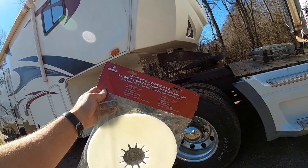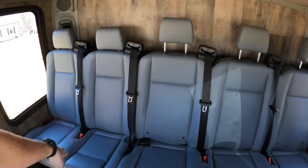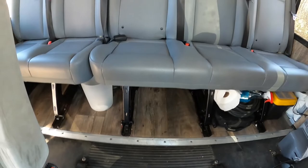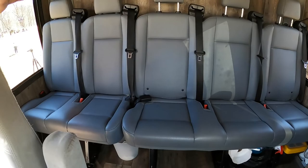This Husky brand has been about the best lube disc I've found. This is a triple bench and a double bench, so that makes five passengers — all with seat belts. These seats come out of a Ford Transit van and I bolted them down with five-eighths bolts all the way through the floor, with really big washers on the bottom.